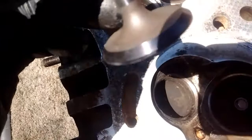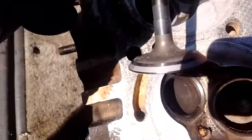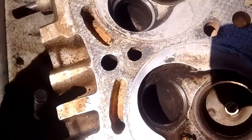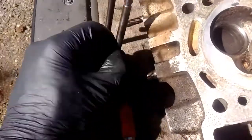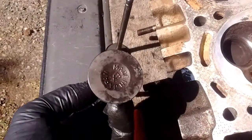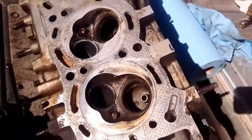For comparison purposes, this is the surface of a valve that's brand new and has not been ground — see, it's black. And this one's been ground. After you do that, you can take some marking paint like a pen here, and mark underneath the valve which number cylinder it is. In this case it's cylinder number two. Thanks for watching.